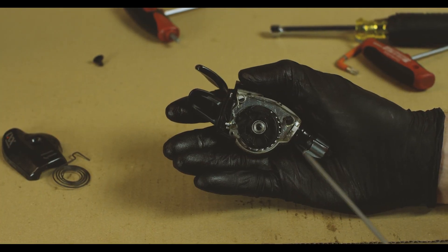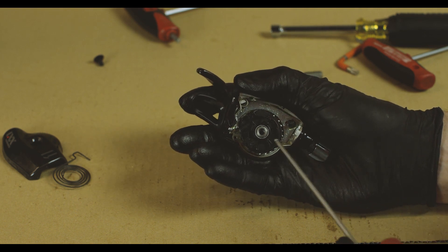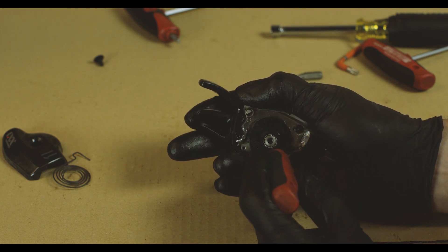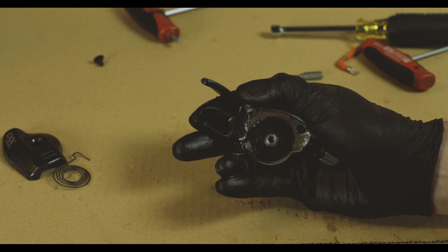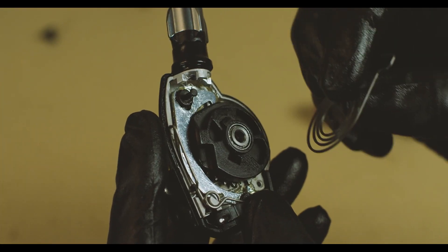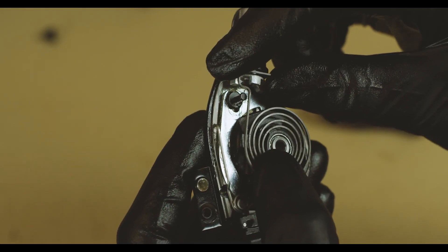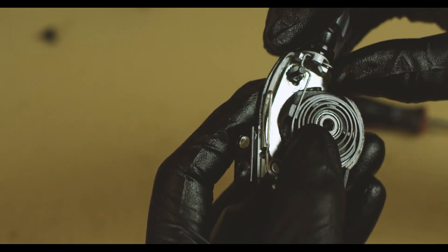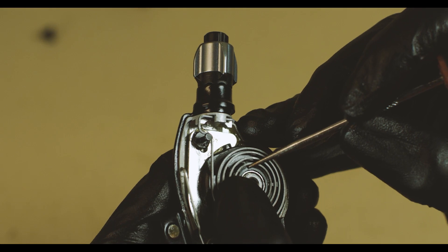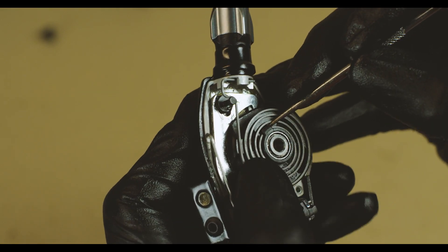Before installing the spring, we're going to have to walk the spool manually back to the relaxed position. Hold the shifter and use your 3 or 4mm Allen and pull that lever with a finger — just walk it back like that. Now we know we are in the relaxed position and we're good to reinstall the spring. Take the inner bend of the wire and drop it into this square hole right here next to the E13 logo. The other end pretty easily fits around this peg. It's extremely important that we push the inner coil of this wire underneath this plastic tooth — the shifter won't function correctly unless you get that in there snug.